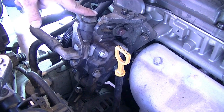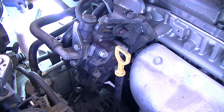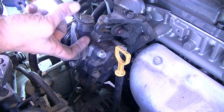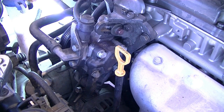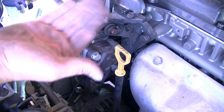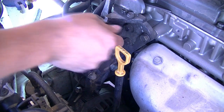A note about reinstalling the power steering belt: since it doesn't have a lock tensioning mechanism like the other belts, you just push your pry bar here — you can rest it against the bracket for your engine cover — then push it to tension it. Once it's tight enough, tighten this bolt and that should do it.